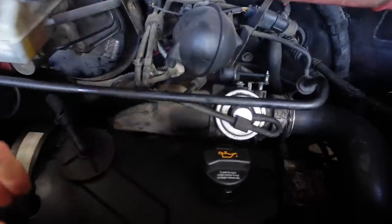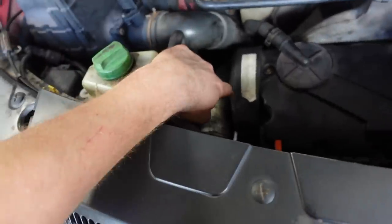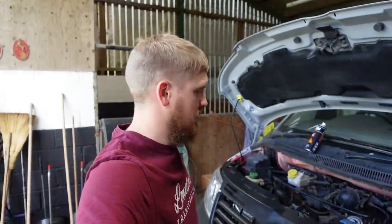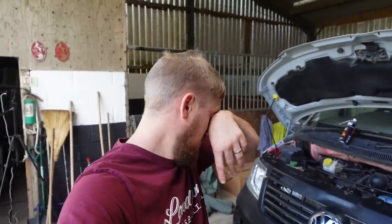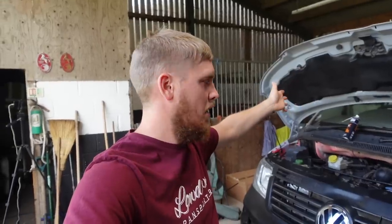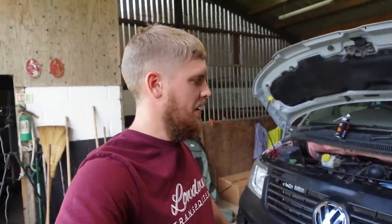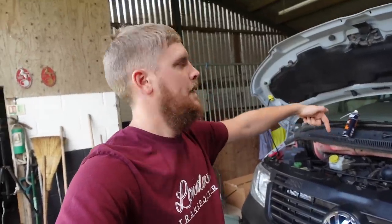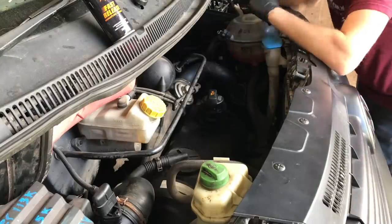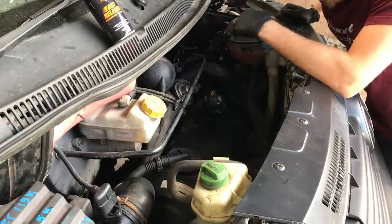Let's just get it out. I can't see it being majorly difficult. We're going to take all of this out — the exhaust manifold off, air box out, cam belt off, pretty much exactly what we did for the cambelt job. Rocker cover off, start unbolting things to get down to the head. I'll try and document it as best I can. I've never done it on one of these before so I'm learning as I go. Let's drain the coolant for the fourth time.